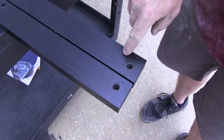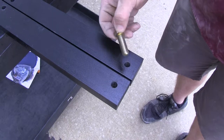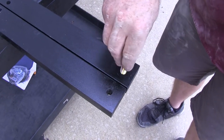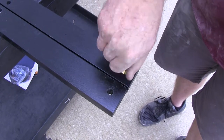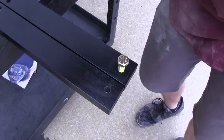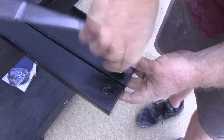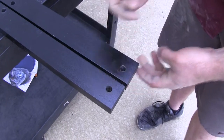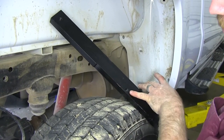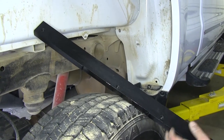Before putting our cross rails across the top of the frame rails, you'll want to take one of the half-inch bolts that comes with the kit and thread it into all of the holes in the rails to make sure that the powder coating or any debris doesn't keep you from being able to easily thread them in by hand. Be sure to do that on all holes on both cross rails. Now we'll install our front cross rail, making sure to install it with the holes closer to the bottom.